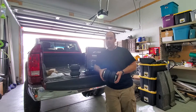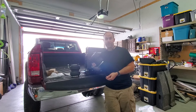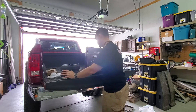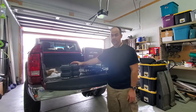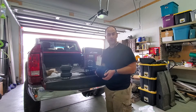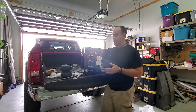If you're a subscriber of our channel or you watched our last video, you saw that we installed a gooseneck hitch in our Ram 2500. Now we're going to put some airbags on it so that when we load down a heavy trailer, we can take the squat back out of the back of it. What I got today is Airlift brand LoadLifter 5000, adjustable air springs — the 5,000-pound models. They make a 7,500-pound model, but I didn't think I needed that. This is a 3/4-ton truck, not a 1-ton truck, so this should be sufficient.